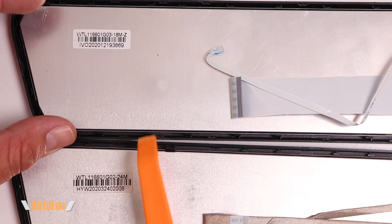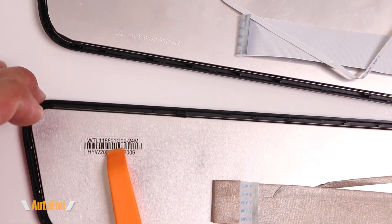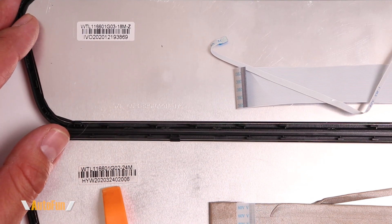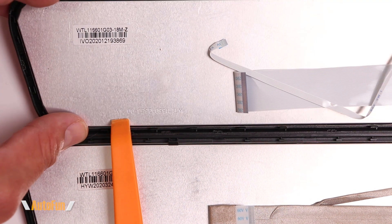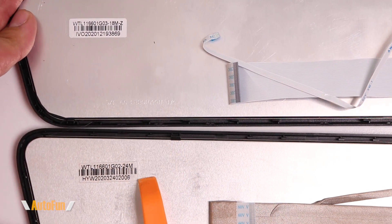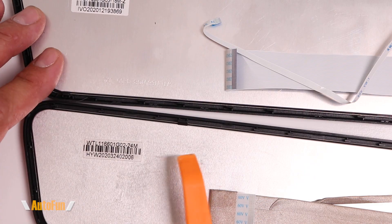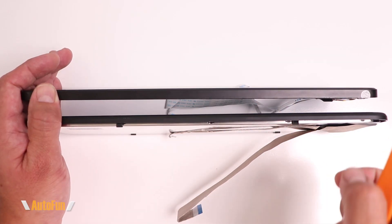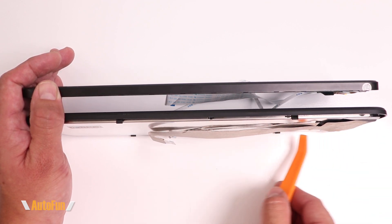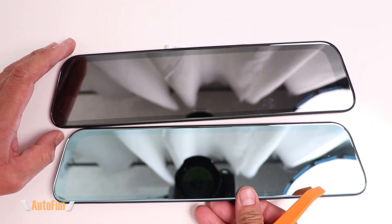While you could argue the AutoWell works just as well without the shielding tape, you can see AutoWell saved money by deleting this item — no tape to buy and no labor to apply it. You can also see stamping on the back of both displays, along with part number stickers. If you look at the part number structure for both, they are very similar — the stamping indicates 'JXC.' I strongly believe these displays came from the same vendor, one sold to AutoWell and one to Van Top.